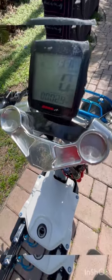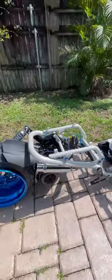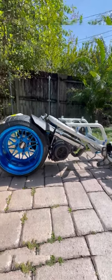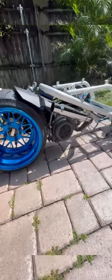You can see the charging system is healthy — it's where you want it to be. Got a nice little taste of that exhaust — that's how we want all our bikes to start up. Even though it's carbureted, not fuel-injected, it's simple. Usually when the bike is off and you haven't ridden it for a while, you just pop the choke right here and fire it up. We had gas in there already, so the bike starts up very easily, and the idle should be good — around 2,000 RPM is where we set ours.